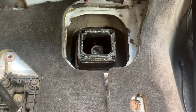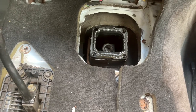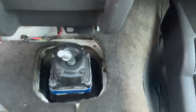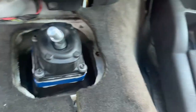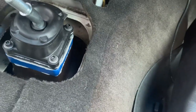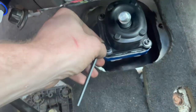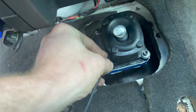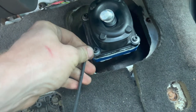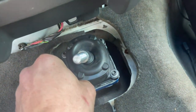I'll flash back once all of this is cleaned up and ready to put the short throw on. I didn't get to film the silicone part because it was the most tedious part, but I was very generous with the silicone — I will clean it up. Basically all that's left is to tighten the rest of these allen keys down pretty decently tight and get this all sealed up and get the shifter installed.